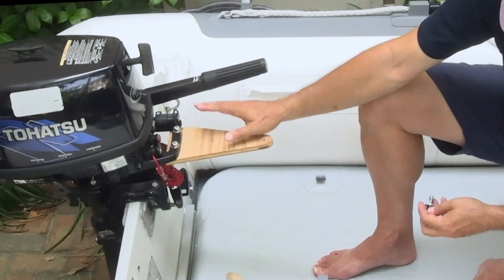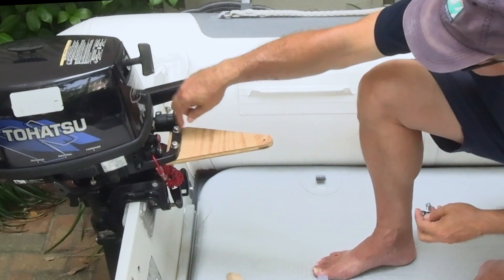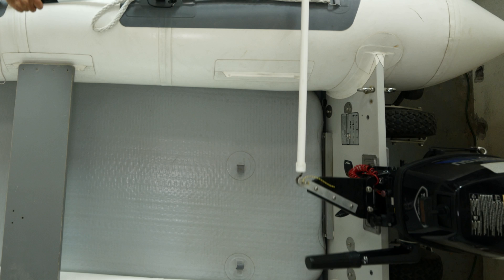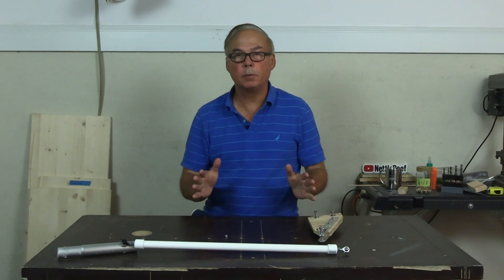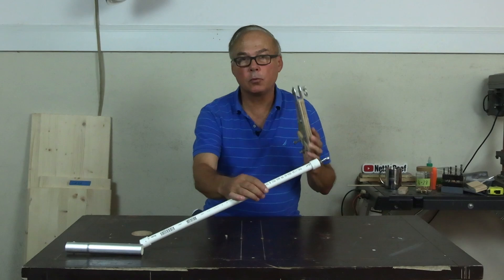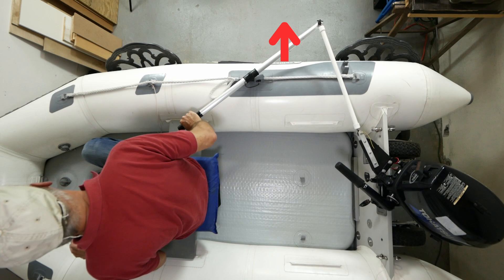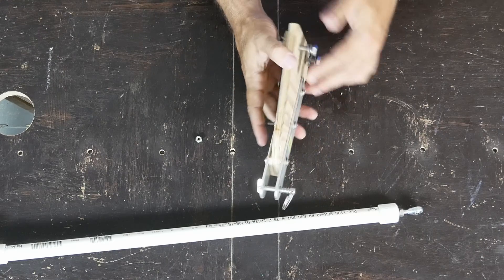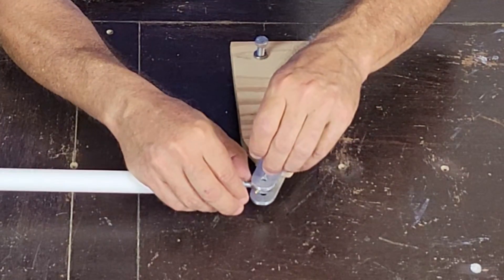The final part to make is the motor bracket. I made it out of a scrap of half-inch plywood. My motor has two holes in the carry handle, so I drilled a couple of holes in the wood that lined up with those holes and bolted it through. Its shape is such that the tie rod end is slightly off-axis from the center line of the boat and closer to the steering arm side. This allows for a little wider engine rotation when turning to starboard. If you're tying up to a dock or another boat to starboard, the motor end of the tie rod needs to quickly disconnect from the motor bracket, because the steering arm will extend outside the boat and could hit the dock. I attach one-eighth by one-inch aluminum strips on the top and bottom of the motor bracket with holes for the clevis pin to go through. The pin goes through the bore of the tie rod end, in between the aluminum strips.